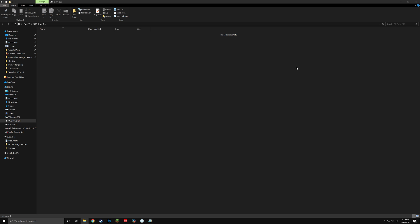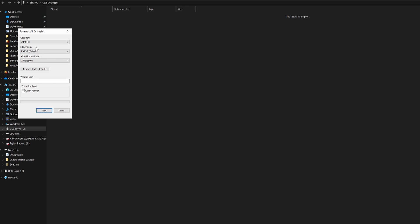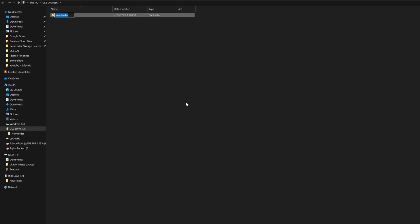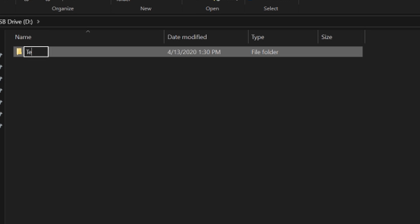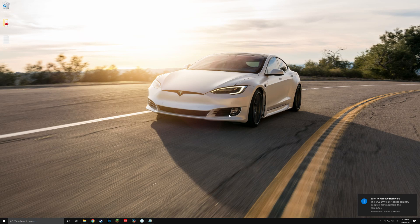We've got the USB in the computer. This is for anything 32 gigabytes and under. We are just going to hit Format, set it to FAT32, check Quick Format if you want this to go faster — it's basically instant — then hit Start. Once that's done, you are now going to make a folder and call it capital T, capital C: TeslaCam, one word. Then eject safely — don't just pull it out. Now you can go put it in your car.